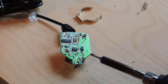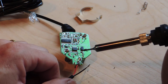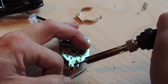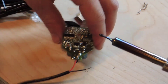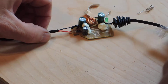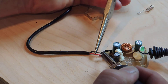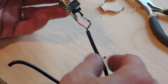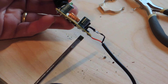It just took a little fiddling to get that spring off. Now I've tinned this wire — the red wire is positive. I'm going to solder that in place and then flip this over and solder the two ground wires together. I don't pretend to be the world's greatest solderer and this won't win any awards, but you need to solder the positive cable here and the negative here, then cover and protect it somehow.